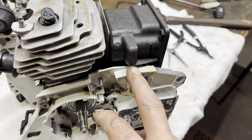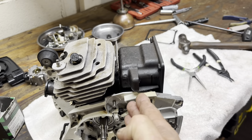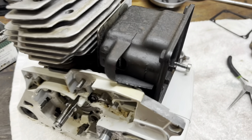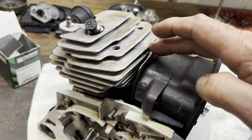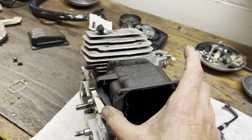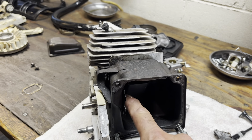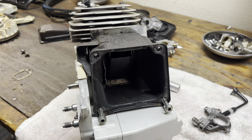I said no performance work, but I went ahead and opened up the exhaust port. What you need to be mindful of: they know what they're doing with this little tiny deflector. If you try and hog this hole out farther than it started, you will burn your brake handle right here — you'd run a very good chance of melting the plastic brake. So just keep it back in there; you can get a decent hole. When you put the heat shield and gasket on there, before it's tight it will wiggle around a bit. Start your bottom hole bolts to pre-align, and then torque down your two muffler bolts — that way when you put your front cover on, everything will line up nice and pretty.